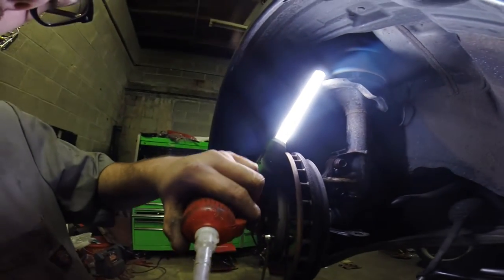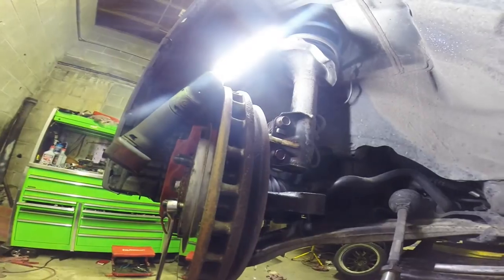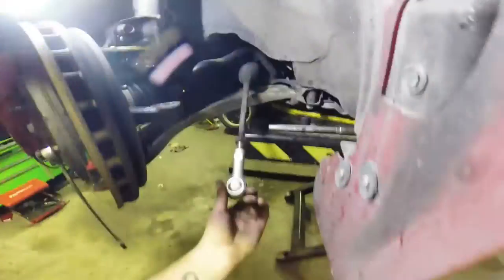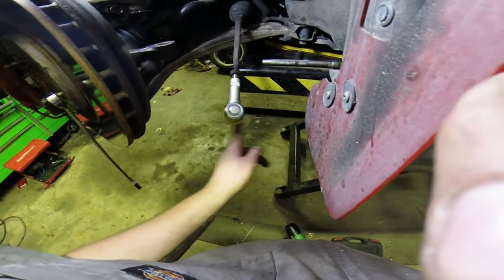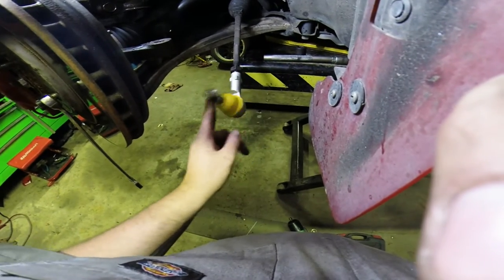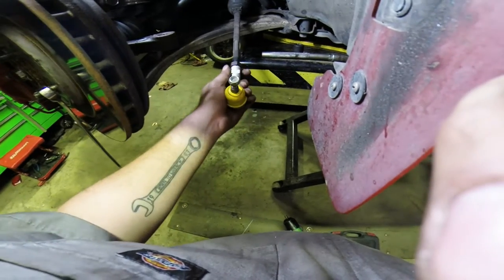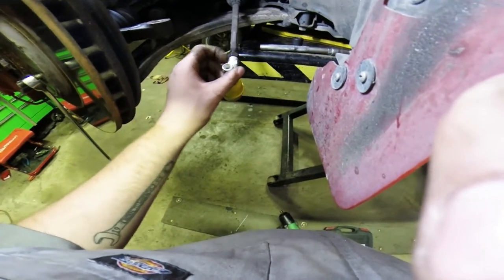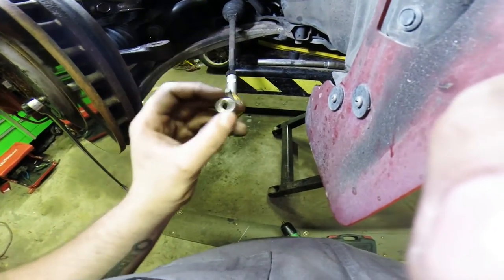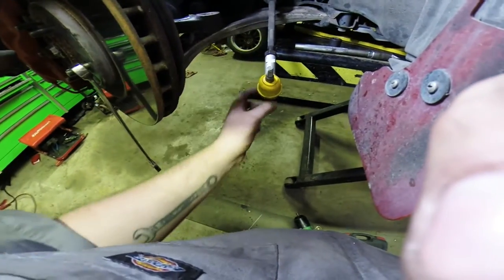I'm out of anti-seize so I'm going to use some dielectric grease — still the same. I'm going to squirt it in that hole there. We said it was 14 turns, so it's on the threads inside of there. Get this started. That's one, two, three, four, five, six, seven, nine, ten, eleven, twelve, thirteen, fourteen — so that's our 14th one. Now take off our new nut. This has a nylon washer on the inside, so this is a one-time use. All suspension components for the most part are going to be a one-time use nut — they should be replaced.